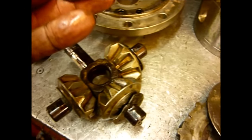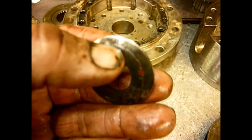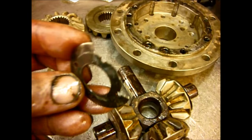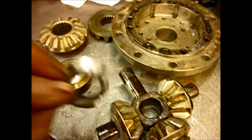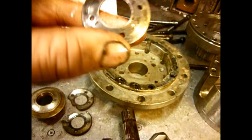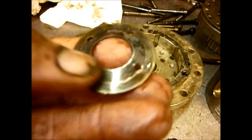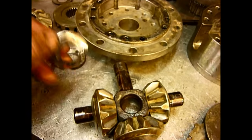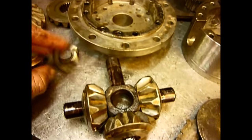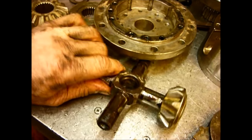On the back here are the early shims, and as you can see this one is cracked all the way around. The next one has a nice big chunk missing out of it, as does the one after that. The last one has a whopping great crack — you can actually see it running all the way around the centre area. What is quite good, apart from this damage, is that the unit has a forged cross shaft which is remarkably strong. I've never ever seen one of these break.